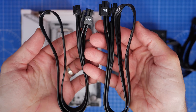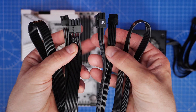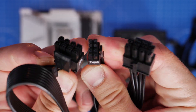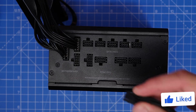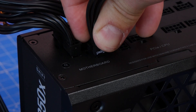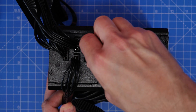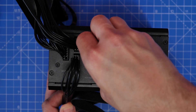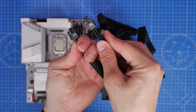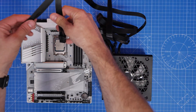You also have two additional cables marked CPU. These are EPS power cables that connect to the top left of your motherboard. Some motherboards have two 8-pin ports, some just have one, and some have one 8-pin and one 4-pin. The Type 5 end plugs into the port marked 'motherboard' on the bottom left, or into the PCIe/CPU ports next to it. The other end runs up to the top left of the motherboard and plugs in — these also have little hooks that clip over the plastic port.